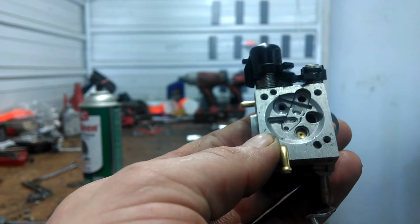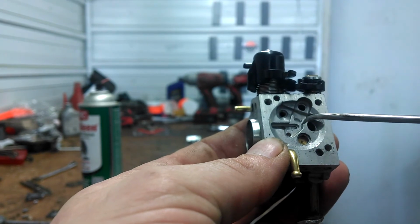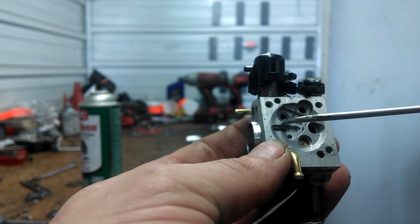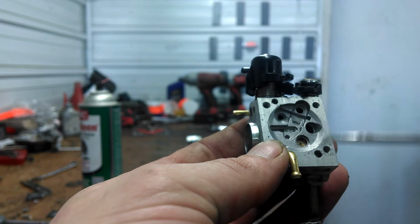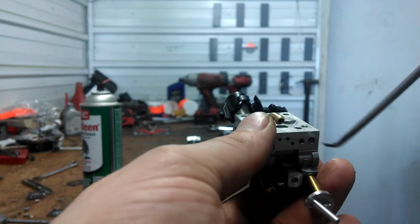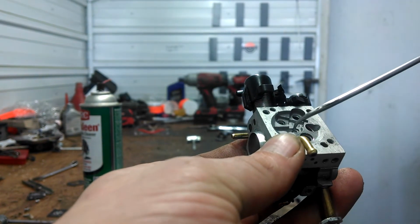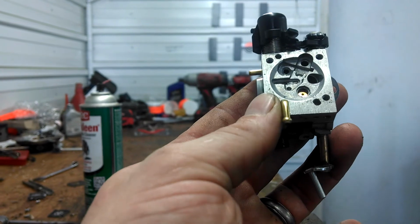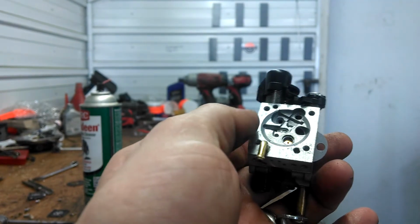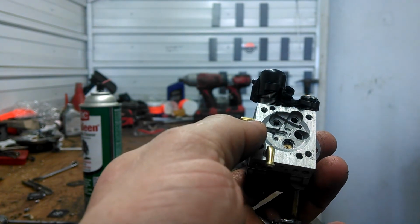The problem we seem to be having with the EL46 is this transition from here to here, meaning how the computer maybe, or how the carb is reacting to fuel flowing from 1, 2 to 3 and then going into the main jet nozzle. The main jet nozzle is fed right through there, so it is almost a straight path, boom, right through there and into there, and you will still have a little bit of fuel coming out of the lows. So right now we've tried swapping nozzles, and that has seemed to richen them up quite a bit, but not completely get rid of the hesitation issue.